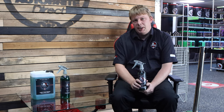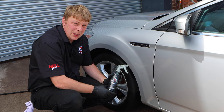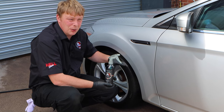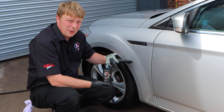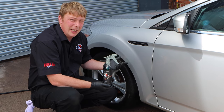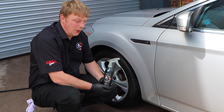Follow me out to the bay and we'll take a look at what it does and how it works. So on some cars tar might be hard to see, so you might not think it's there. Best thing to do is just apply a little bit and see if anything reacts. Chances are there is going to be some tar somewhere, and if you don't get it at this stage you will end up removing it with your clay, which will clog your clay up faster. So doing the chemical decontamination is always worthwhile.